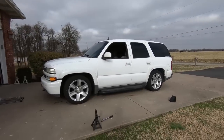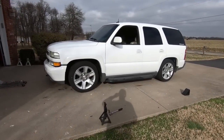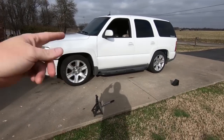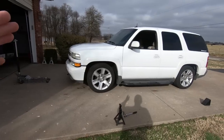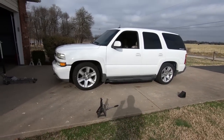So I'm now on my second drive. It came down quite a bit, about 1.5 inches, and I turned it 7 times. I counted on one side, counted on the other. I did take the driver's side just a hair more because it was a little higher, and still is by about 1/8 of an inch, but I think I want to go about another 1/4 of an inch.